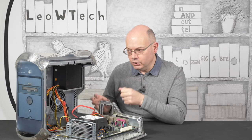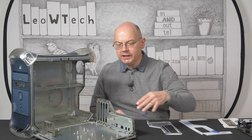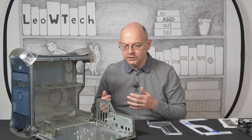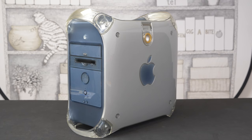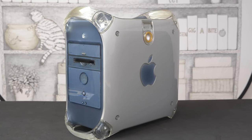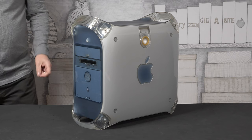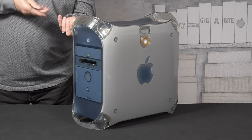The point here is this is not how I want to do the job. Before I can install the motherboard I'm going to have to remove all these standoffs and lugs and whatnot. I'm going to have to open up the bottom of the chassis to allow some air to flow, because I don't want to be doing that later in the build. The key point here is I am NOT building a Hackintosh — I'm putting a Windows PC inside this rather glorious old Apple Power Mac chassis. First job is to remove the panels and strip down to the bare chassis.